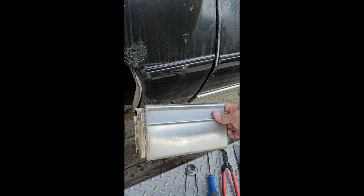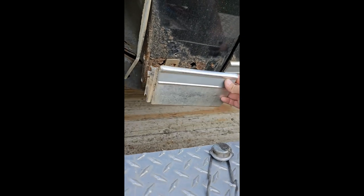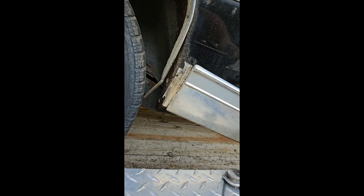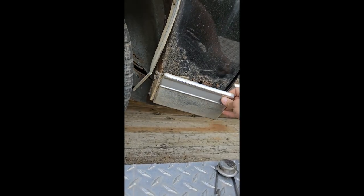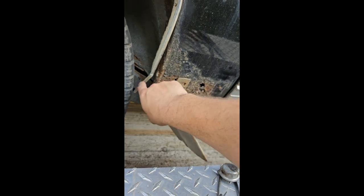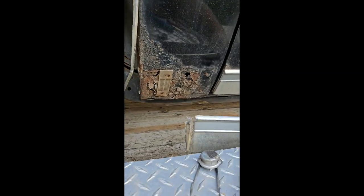This rocker molding — generally you're going to have a lip like this. You will have two screws underneath the wheel well lip, so you will have to take those out. Sometimes, depending on the installer, they would have put the same two screws in the wheel well lip as they would have in here. A lot of times these are just put on, then the wheel well lips are put on with different screws — you might have one screw here for the wheel well lip and another one up here. It just depends. They were all self-tappers back then, so it didn't really matter.